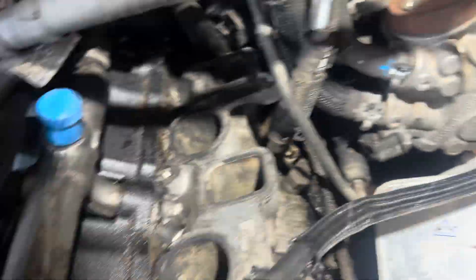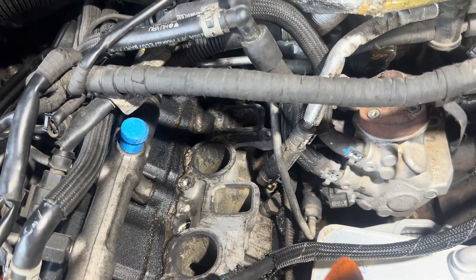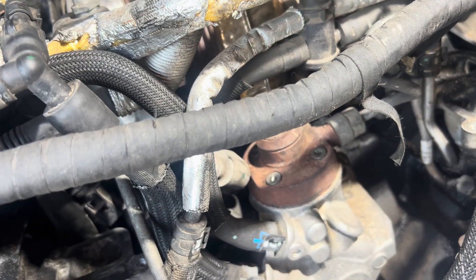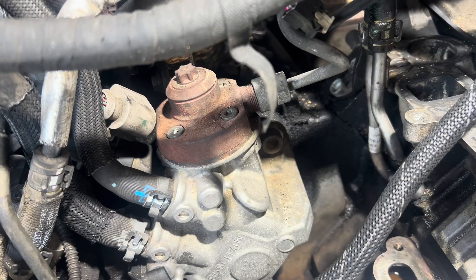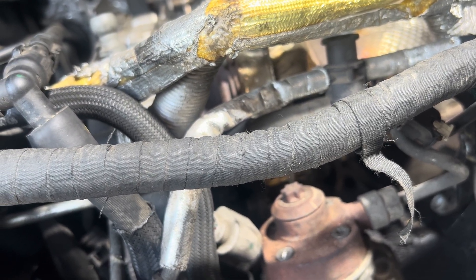Way down the line, you're going to have to remove the intake manifold. I have another video which I will link. Take off the intake manifold and you'll have access to the high-pressure fuel pump right here. There's going to be one connector on the metering valve back here you'll have to take off, three bolts, two low-pressure lines, and two high-pressure lines. From there we'll be able to get it out. But there is a sprocket attached to the timing chain — the timing chain is in the back of the motor. That sprocket will fall down or lose tension when you pull the pump out if you don't have the correct tool in the back. You have to remove this pedestal assembly, which supplies oil to the turbo, to get to that. So you're going to have to remove the turbo first.